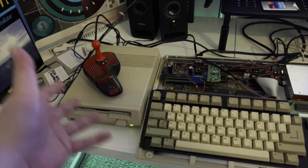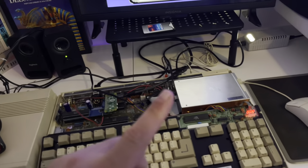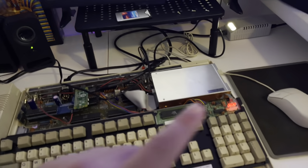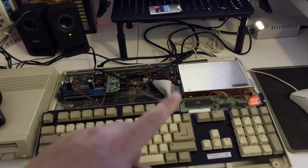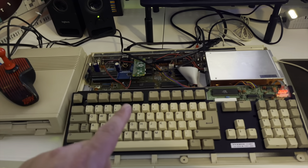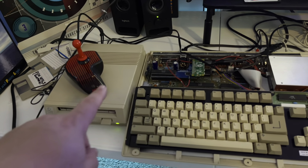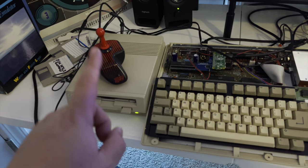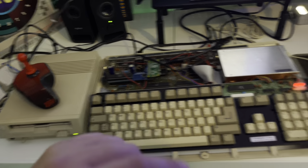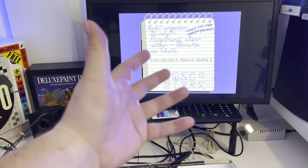And here it is all these years later sitting on some poor YouTube user's desk, trying to show you all about it - to keep the dream alive. But hey, it worked! You can burn discs at 10x and it still reads them. And as long as you have an Amiga 500 with 1.3 kickstart - the acutely aware Amigans among you noticed my Amiga has a red power light, not a green power light. Yes, this is a red power light Amiga 500, so it's NTSC, but more importantly it's a kickstart 1.2. I had to actually put in a kickstart 1.3 to get this to work - kickstart 1.2 does not let you put in CD drives, and I don't even think it lets you put in hard drives. You have to have a 1.3 kickstart minimum. So there you go - I hope you appreciated all my efforts. This is a disaster, I have to clean my office up now. Thanks for watching.